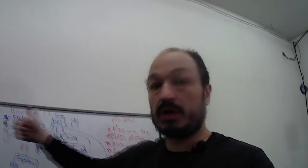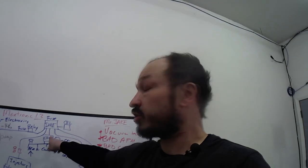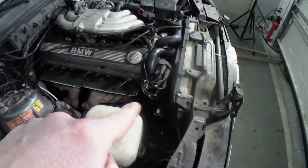if you got this far and the DME is turning on, look back at our diagram. DME is on, we're good there. We're not worried about that. Next thing is the crank position sensor has to work to tell the DME that it's turning over. Where's the crank position sensor? Let's check that out. My hood is off the car because it makes it easier, but the crank position sensor lives down in this area, okay, here, and it is right there. That's the crank position sensor right here.